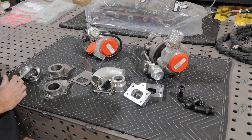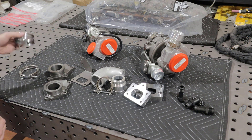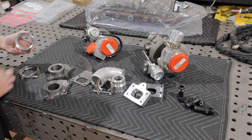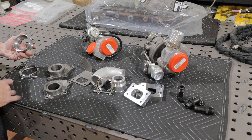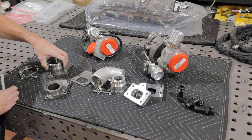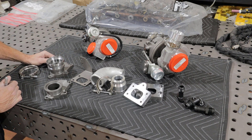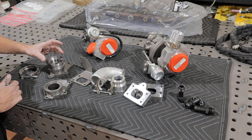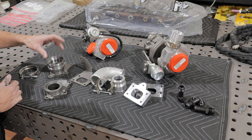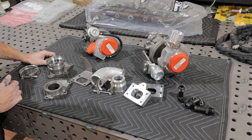Regardless of application, people will need a way to adapt an exhaust, so we have our 79 mm V-bands. This works on every turbo that we have manufactured. We match the profile of the Holset V-band, and we made it a little bit oversized — about a sixteenth oversized — because most of our customers are doing a swap, not a ground-up install. So if you have scale on the pipe or it's dinged up, it'll still slip in here with just enough play, and then you can just make a bead around it and be done with it.